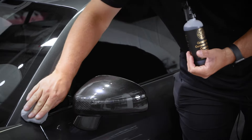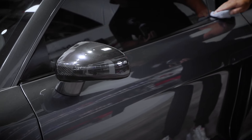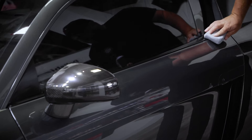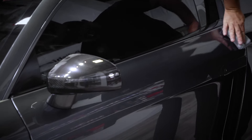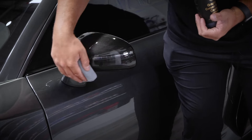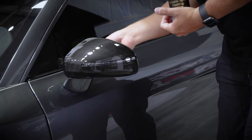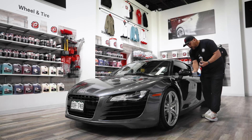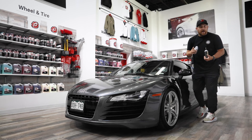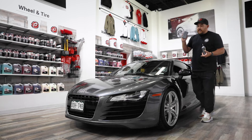Going straight onto the plastic along this section — it makes the plastic look amazing. I'll do this section of the paint, and I'm also going to do the mirror, which actually has some PPF over the carbon fiber. I'm not worried about that — coat over your PPF. It makes it so much easier to clean and it helps reduce the yellowing that happens from the sun on your PPF. So coat your PPF.